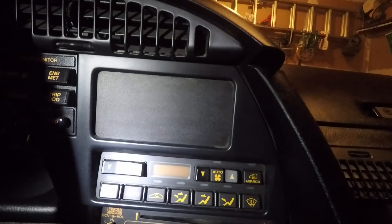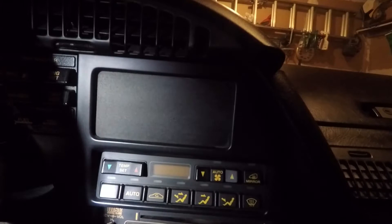What I'm going to do today is check the codes for my FX3 adjustable suspension. I'm going to do that by jumping two pins — A, which is the ground, and C, which is the third one over — and I'm doing that with a paper clip. I'm going to jump A and C and count my flashes. I'll explain to you how to count flashes. Now I'm going to turn the key to the accessory position.